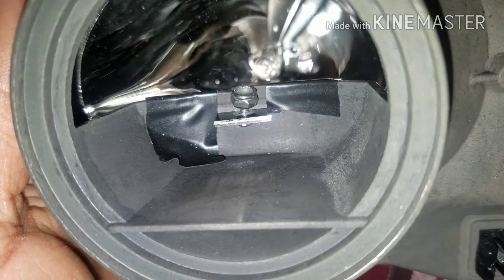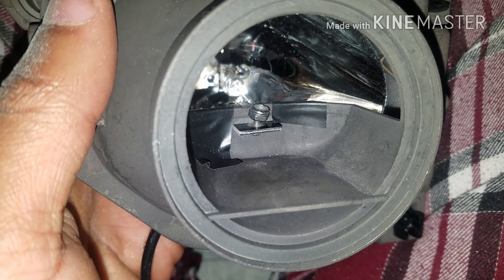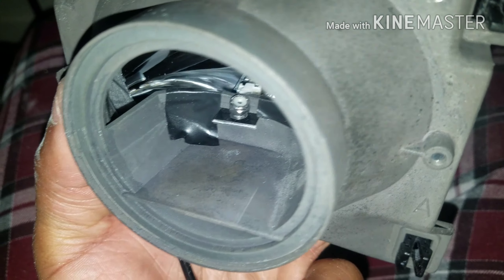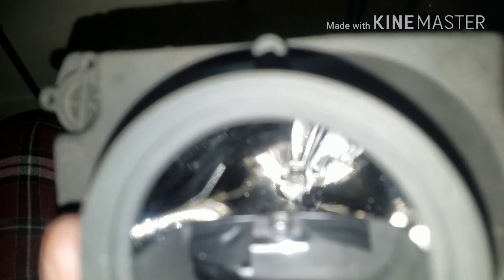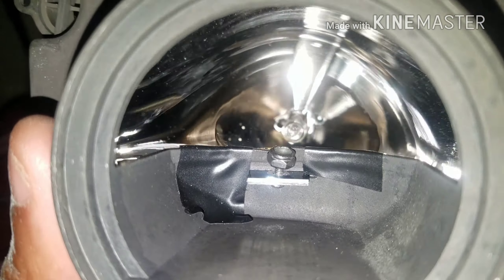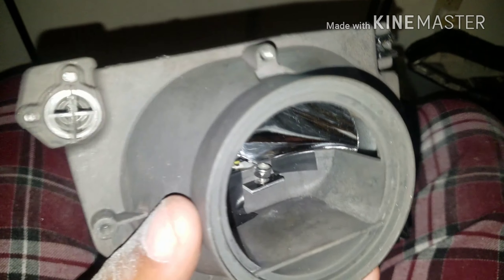This is the final result — ignore the nut that's still loose, I still have to tighten that — but this is pretty much how it's going to look. It's not touching the actual bulb, it's not moving around. This is with the housing on, bolted down, and I made a little notch for the cord to come out. So that is how to install an RGBW demon eye into an S15 housing. Before resealing I'd recommend cleaning the reflective piece and the lens so no dirt gets sealed in there permanently, but I'll do that when I finish the whole build.